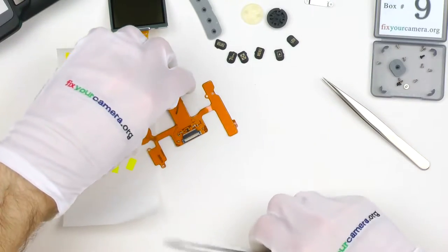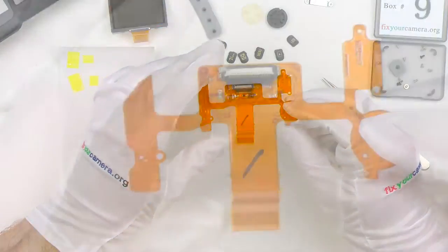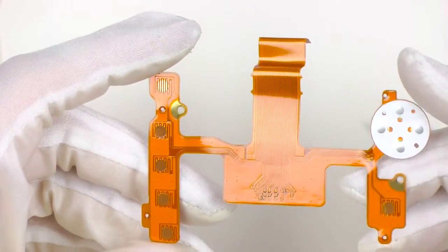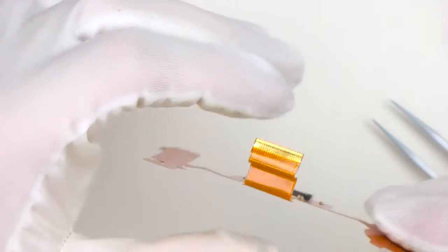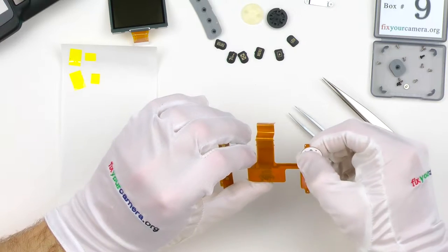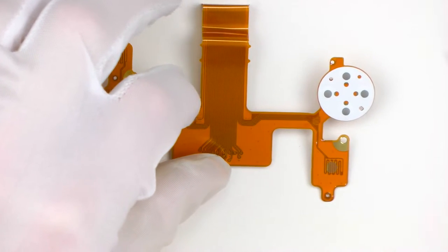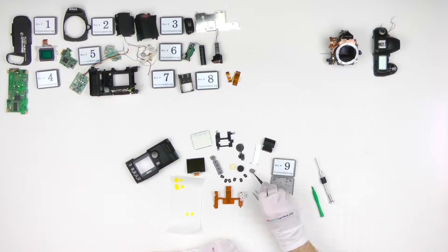When it comes to problems — common problems with rear covers besides scratches, cracks, and obvious things — it's liquid and corrosion. Even a tiny amount of water can make one of the buttons permanently shorted. Very common. It often appears to be a big problem: the rear LCD doesn't come up at all, there is no reaction to buttons, and if you are not aware of this while trying to repair your camera, it can be very challenging to find the cause. A quick contact cleaning is usually enough to solve this problem.